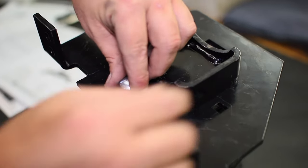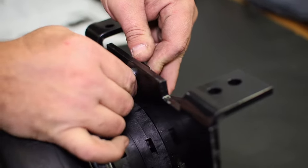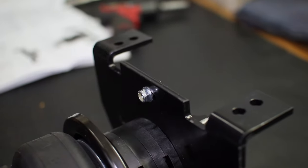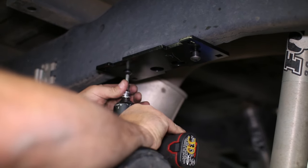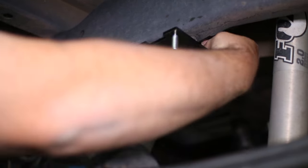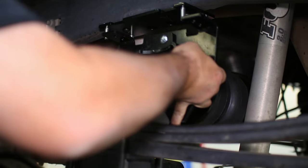After the spacers are clipped together, mount the rear block plate to the bottom of the airbag. The carriage bolts can be slid through the airbag plate as well. If your truck has a bigger rear block than factory, you might need to source longer bolts than Airlift includes with the kit. Back in the wheel well, we slightly loosened the frame plate to insert the four airbag mounting bolts through the top, then buttoned it back up. The airbag slides into the rear suspension with the long carriage bolts carefully routed around the brake lines by the axle.